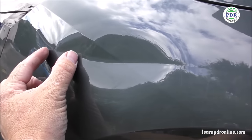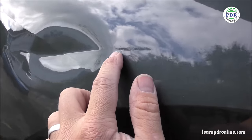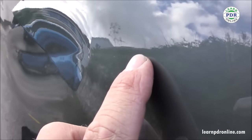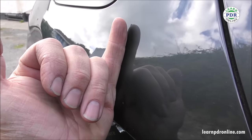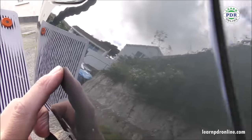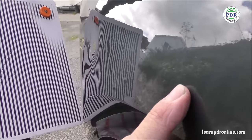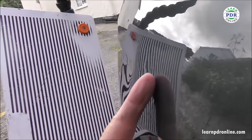So that first pull pulled out some of this dent and it's just started to move. Bringing it slightly shorter. This line here was where my other tab was - you can see I've reduced the dent with that first pull. I've still got that crease running through it, which I'll either glue pull or see if I can get a tool to. But as I've taken that crown and pushed it this way, released some of this crown and pushed it this way, the original crease I was working with the bars and rods is here. My first glue pull was this section, and you can see it's almost taken the tension with it to give what looks like another crown on the back end.